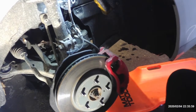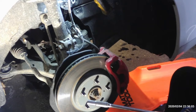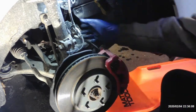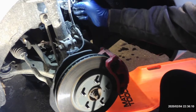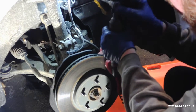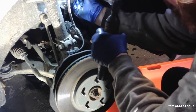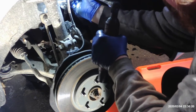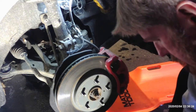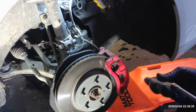All right, so we're on the passenger side. I'm going to go ahead and just take these hoses off real quick like we did on the driver's side. 10 millimeter on the fender well here. You'll see it. Just follow your speed sensor line up to the fender well, and you'll see a 10 millimeter bolt that's holding a long bracket that's holding the speed sensor wire to the firewall. Just going to kind of go back in the order that I had it, so that the tools are already there.